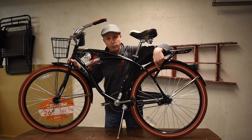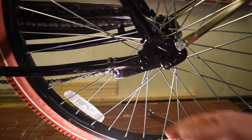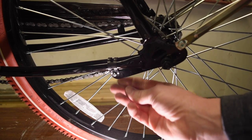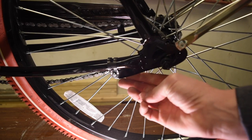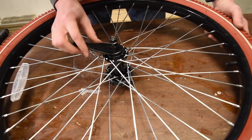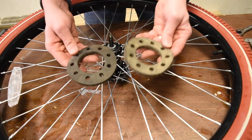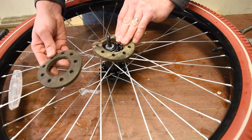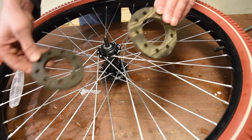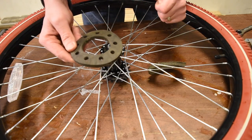The first thing we need to do is remove our rear wheel so we can add our big sprocket to it. To remove the rear wheel we'll just remove the two screws on the opposite sides of the bike. Since this is a fixed gear bike we need to remove this little bracket here, which is actually used for the brakes. Looking at our back wheel, here is the main sprocket that comes on the bike — we need to work on the opposite side. We have these two rubber gaskets; one goes on the outside and one goes on the inside. Since these are solid we need to cut a slice into one of them, cutting in between two of the holes.